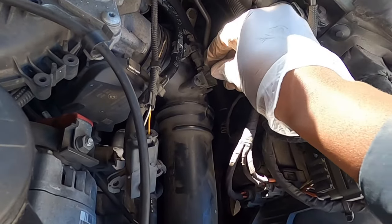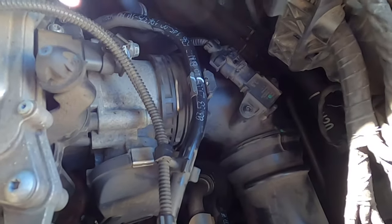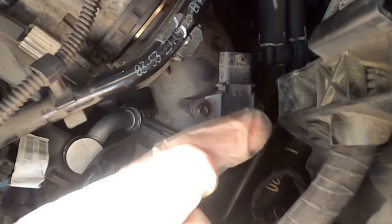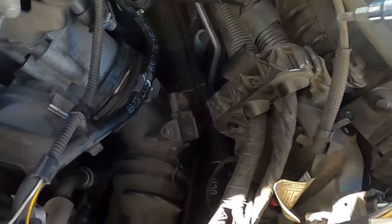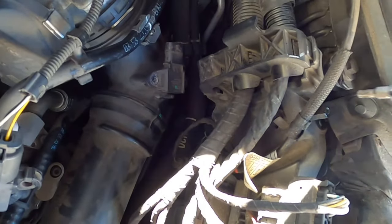These are T25, so just unscrew these two and we'll pop this out right up under here, then shimmy it out — and that pulls out just like that. The only thing is I don't want to lose this, so I'm probably going to have to put a zip tie on that because there's not a lot of play. I just simply zip tied this up here so it doesn't go anywhere. Now we can work on pulling this out, undo these two screws and pop this up. I've got my little extension right here, went behind here, and when you move it a little bit the thing will go right to it.